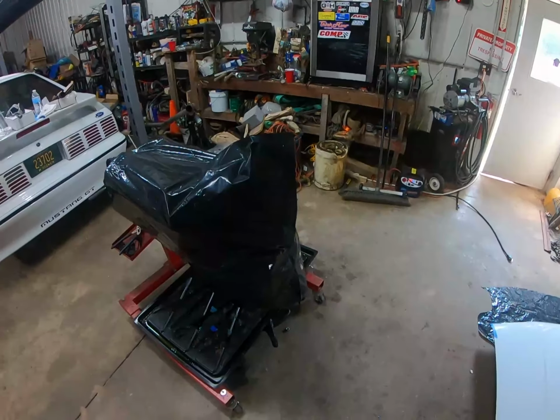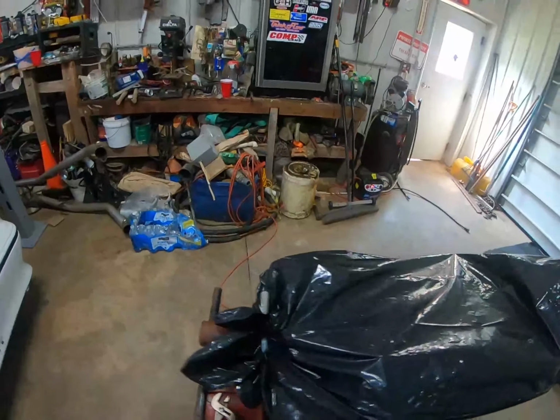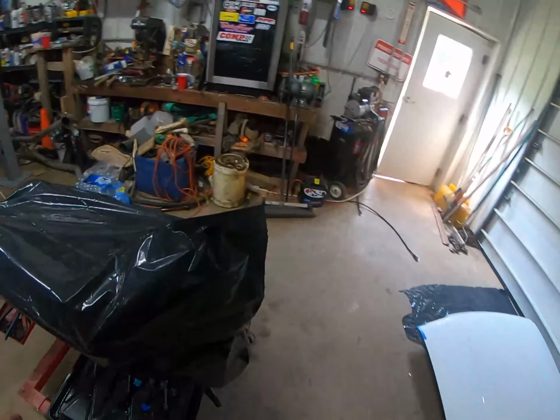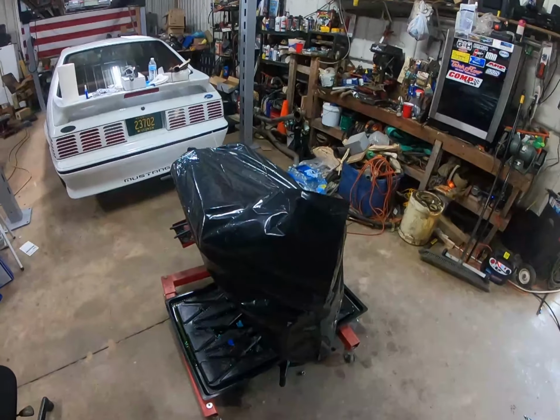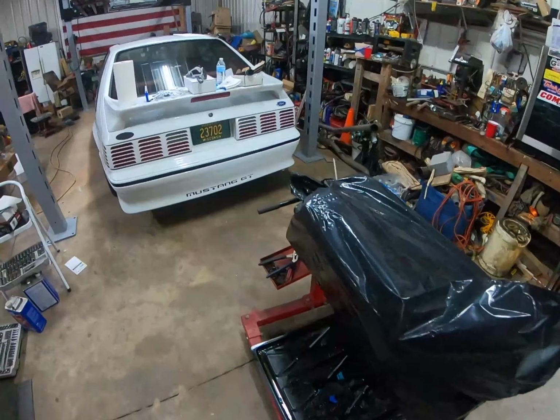So in the last clip, I showed us measuring push rod length. We didn't use the mid-lift method that I had seen Vice Grip Garage do, and we came up with 7.1, and that was where we got our best tracking. Unfortunately the engine is covered right now, so I can't really show it, but I think I wiped the mark off the valve stem anyway.